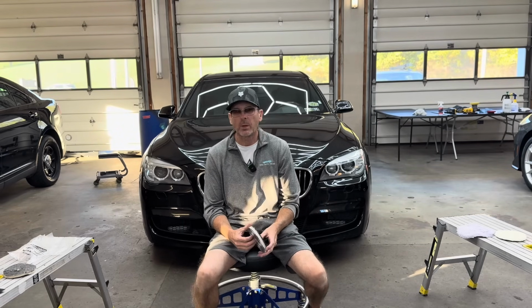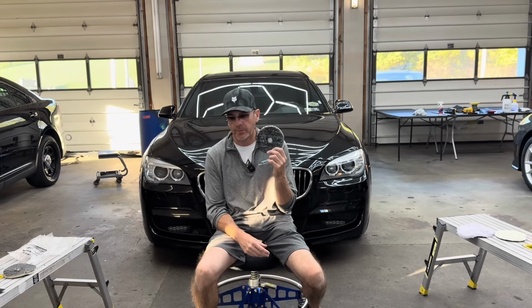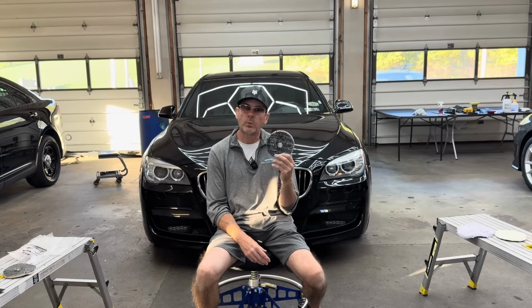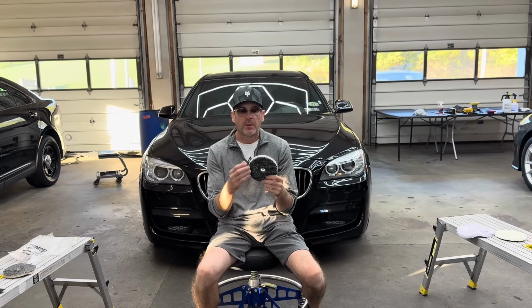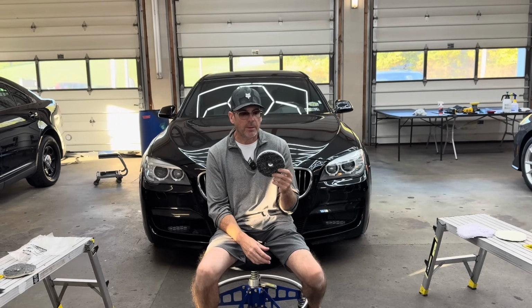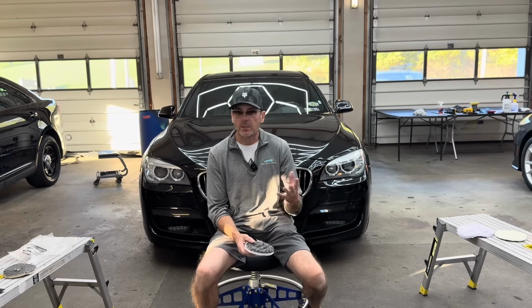2020, 2021, 2022, and newer, as they are transitioning from a real hard solvent-based clear to your water-based. And that means you don't need a pad with just cutting fibers. These are mixed in, so it makes it a little bit less aggressive. And they just do a great job on one-step transformations and corrections, and they cut your time down.